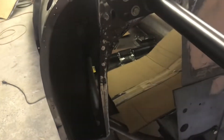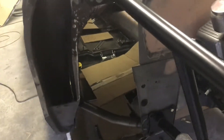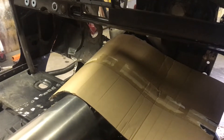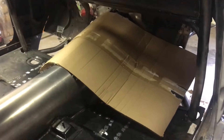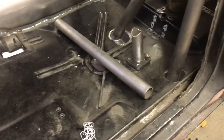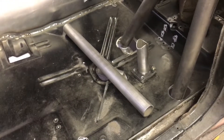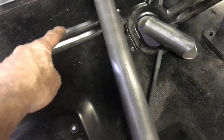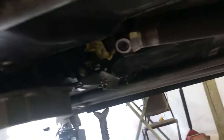The front — just making this hole, filling that in, filling all this in, filling this in. I've got to fill all that in. You just put it where you want it, make it look how you want as close as you can, then lay it back out and it'll be a flat piece. We dropped everything off at Dutra's, gave them a list of what we need — might get it today, if not Monday. Got these all polished; that's basically how those are gonna sit, one on each side. The other plate will get welded to the transmission mount itself, which will get welded to the center tube, and then the whole thing will be removable.